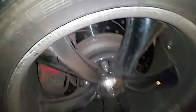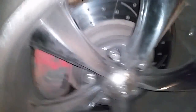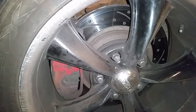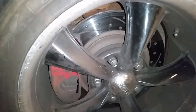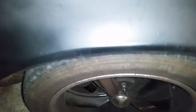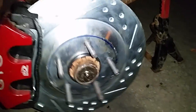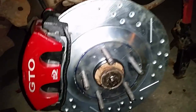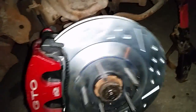You'll need longer studs — I use Morosos. Some GM hubs come with a 480 shank, some come with a 580 shank or a 6-something. In my case it turned out to be a 6-something, so I got Moroso aftermarket studs. I couldn't use the Dorman ones I normally do — they don't make a size to fit. So these are some really long studs, which is good. You'll need open-ended lugs so it threads on through. You don't want to race with short studs.